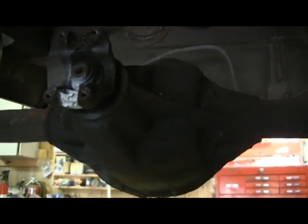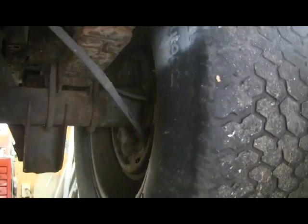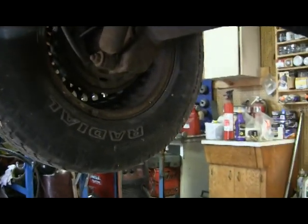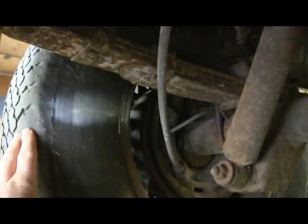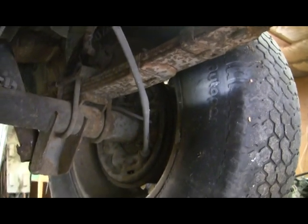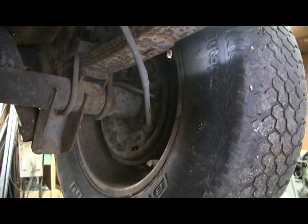So what we're going to do here is just spin the wheels to find out. You have to know whether it's got an open diff — in other words, you spin one wheel and the other one either doesn't move or moves the opposite direction. I'm going to turn this one forward and that one's going forward too, so either we have a limited slip or it's just a little bit tight in the differential. If it is a limited slip, there's no problem as long as both wheels turn the same speed for the math calculation. If one wheel spins forward and one goes backwards, you have to grab them with your arms and spin them both at the same time. I've put paint marks up here by the leaf spring on both sides.